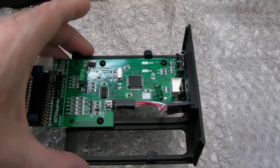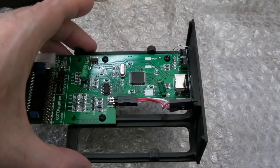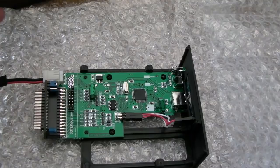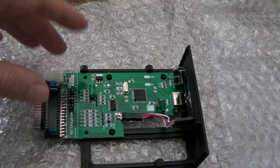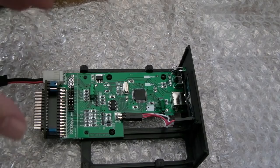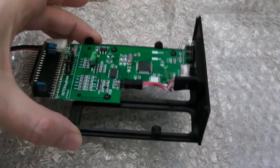You'll notice on my Amiga videos, have you ever seen a Gotek? I haven't fitted one, because I don't see any need with the Amiga. Floppy drives are, in my mind, painful to use on systems when you can load things from a hard disk. The Amiga is very easy to set up with WHD load on a compact flash card. You might need some sort of upgrade to give you a compact flash card in an Amiga, but it's the best way to use those systems. So that's why I generally don't go with a Gotek on Amigas.